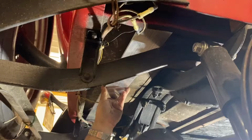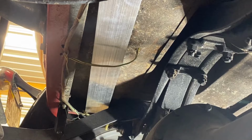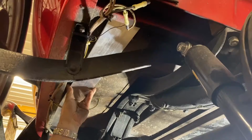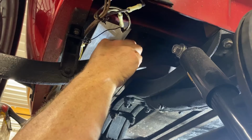With the tire removed, we slid the aluminum plate up and into place at the back end of the body. Once we determined where we thought the middle of the body was located, we marked the front edge of the aluminum, thus dividing the aluminum plate into 2 sides at center. On the 2 outside ends, we determined where the right and left body seams were located, and we marked those as the outer edge of the area where we would plan to put our seatbelt bolts.